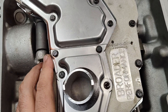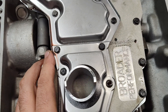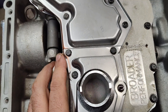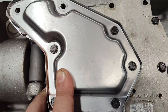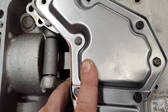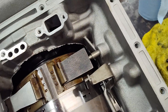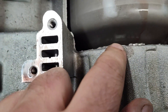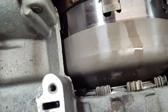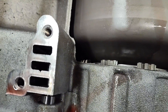I run into this fairly often, which is strange. The valve body is actually hitting the transmission case — it's not that the surfaces aren't flat or something like that. So what I try to do is I'm gonna be rough with this here, just trying to make a mark to see where it's hitting. Because it's spilled oil now. I think it's hitting here — you can see that little rub mark there. It's hitting there, and I think it's hitting on here.